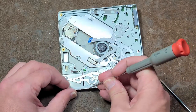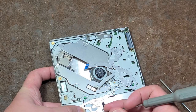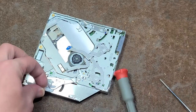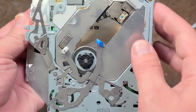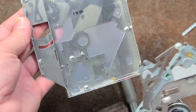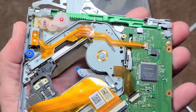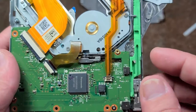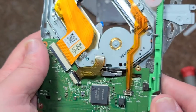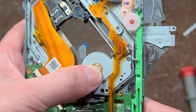It's kind of an adventure just to take these things apart. Now this whole thing ought to peel up out of here, and it really was that easy. Kind of interesting — and there we have the internal mechanics. We have some expected stuff like a little microswitch for triggering when it's all the way open, another one for triggering when it's closed. And little rubber or soft silicone bushings just to suspend the actual carriage to reduce vibration.